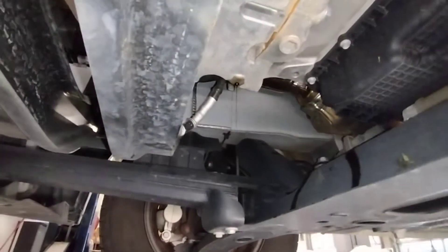Hey guys, there's no reason to put oil filters on so tight. I got this Transit right here, a 250 Transit, and I'm going to show you what I just went through. Hand tight — you don't have to use the impact to put these things on.